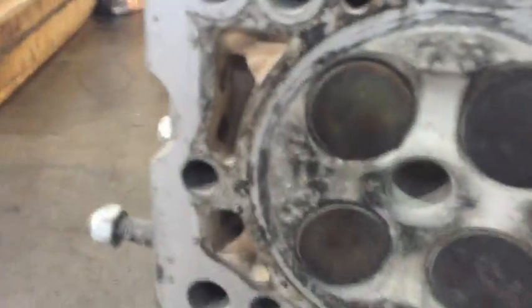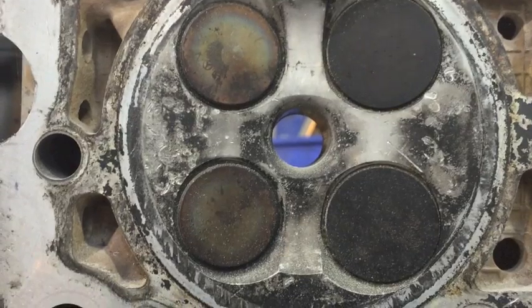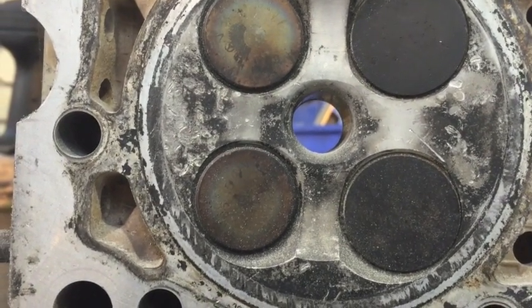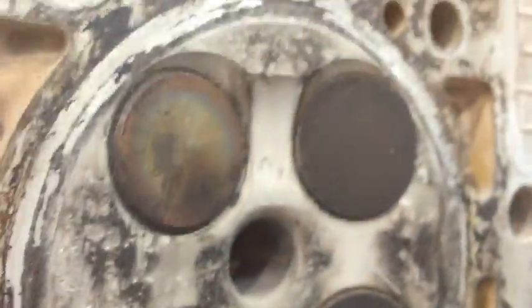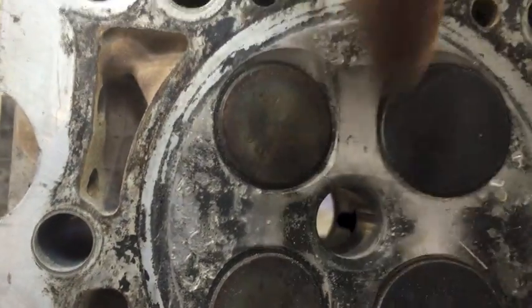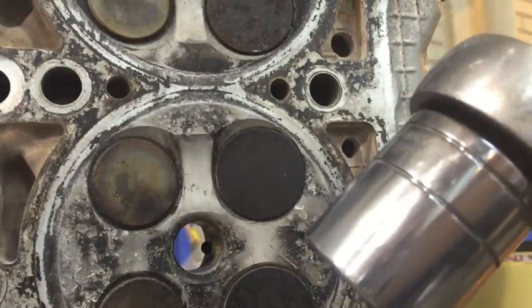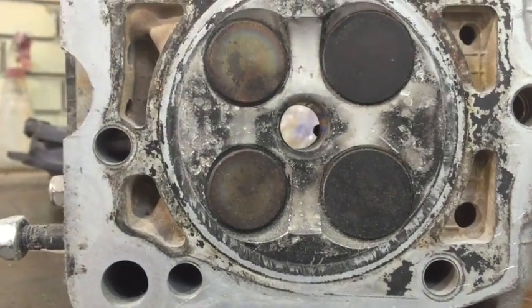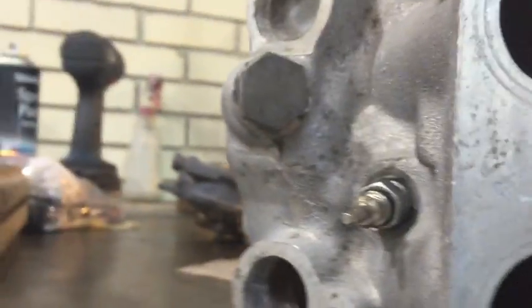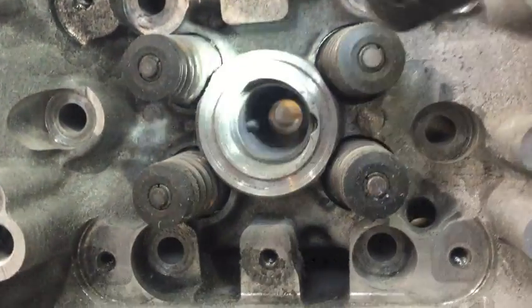Now here's a pre-combustion chamber that I've removed, where you can see right through. Now, if I put the glow plug into the hole and tighten it in all the way in, you can just see it starting to show there. Now that is deep into the cylinder head. There's no banging or tapping or chiseling, no amount of using a large socket to smack the underneath of this is going to bring it out. So basically, the only thing you could do by taking the head off is possibly by soaking this in a bath of lubricant. So there we go, you see. There's the glow plug inside there. Just pokes through that little chamber a tiny bit.